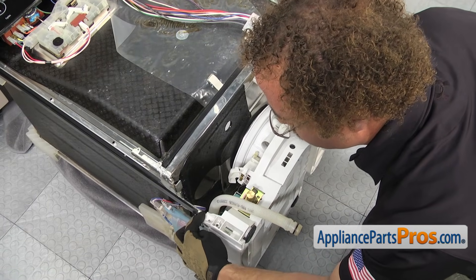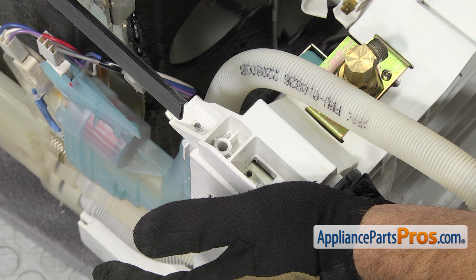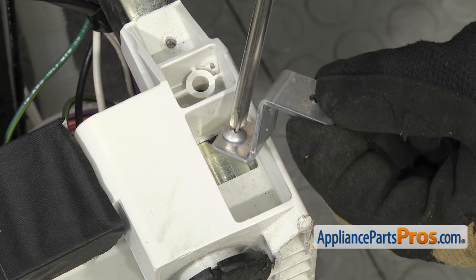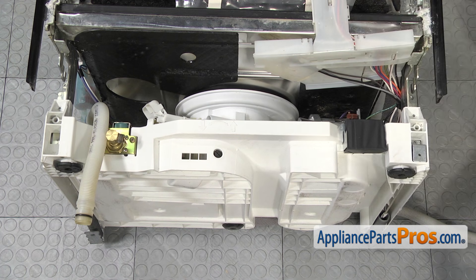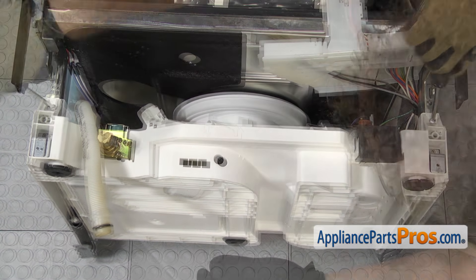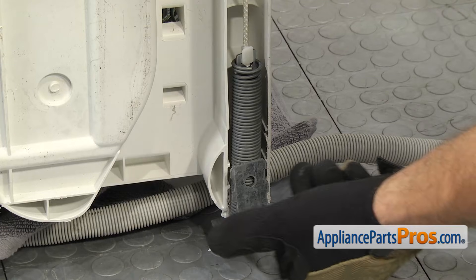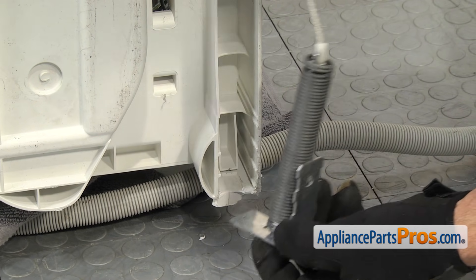Once you have the sump in place, we can lift the base back up and put the screws in to hold it in place. You may have to tap it up a little bit and make sure the screw holes line up. We're going to use our Phillips screwdriver to put these screws back in — we're going to put the ones on the bracket in first, feed it down, line it up with the hole and tighten it down. Once you have the two in with the brackets, then we can put the other two in. Now that we have the base secured to the frame, we can go below and put the springs back on. All you have to do is push them back into their slots, making sure they're all the way on the bottom slot and not on one of the upper ones, otherwise they won't hold.